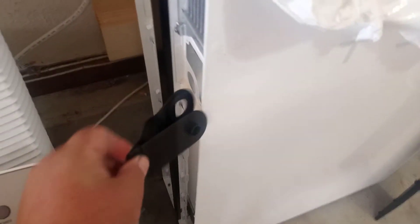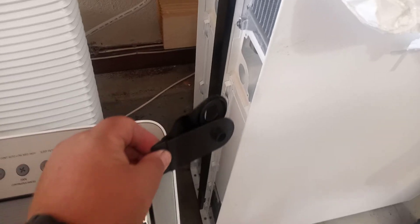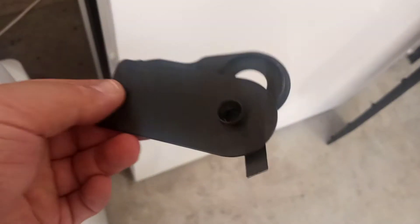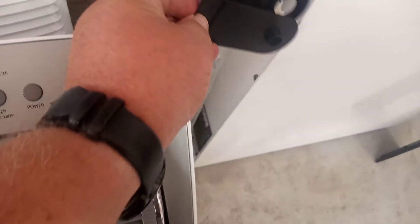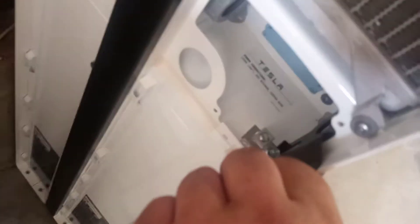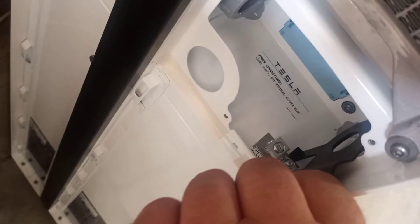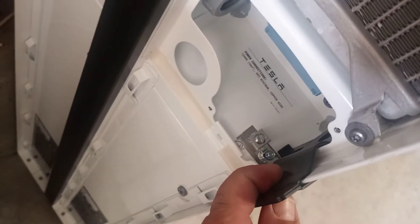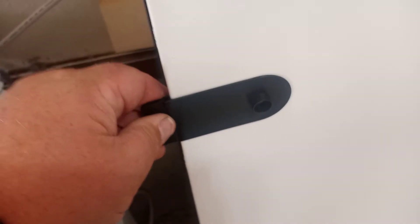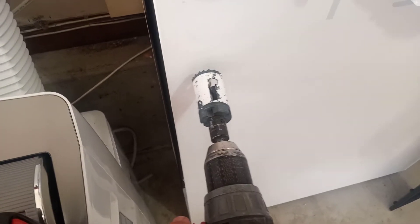So this little tool they give you — there's a little piece of plastic. It has two pieces and they flop inside, and then they have this little kickstand here on the bottom on this side, and that keeps it bolted in. So we're going to pop it in there, and you can see where the kickstand holds it in place and it just locks in there just like that. You want to make sure you're flush with the edge of the machine, and then you'll drill a quarter-inch hole. Once you've got your quarter-inch hole drilled, you'll pull it out and use a one-and-three-eighths bit to finish the hole.